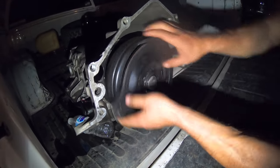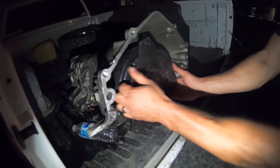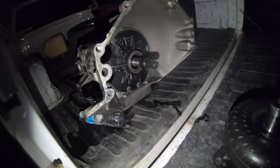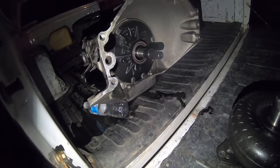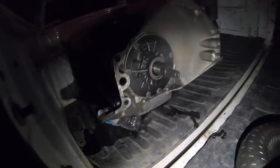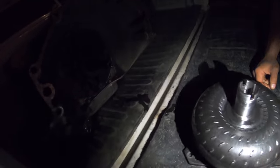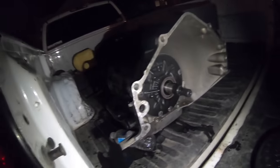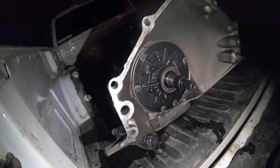The sprag's broke. I thought you drained this thing, man. Oh shit, yeah. I forgot I didn't take the converter off. Oh yeah, damn right. Shine your light in there. Yeah, it sounds like the sprag's broken in the converter. Okay. Didn't tear up the splines or anything, but...